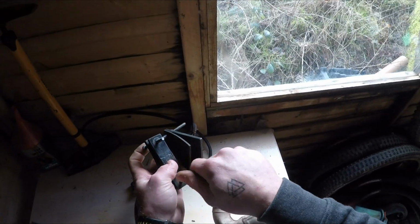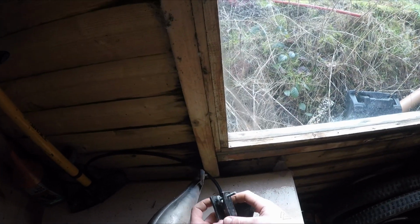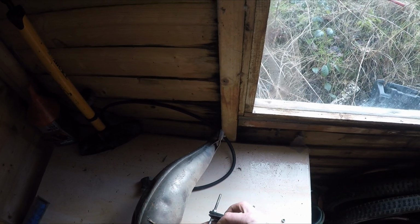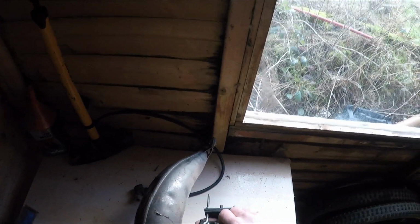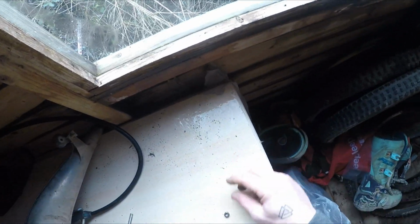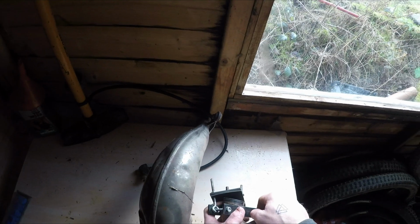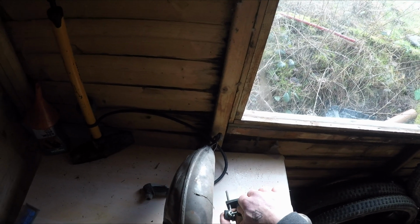This is like my worst part about two-stroke life. The exhaust is just poking out everywhere. So it's the first thing that gets hit really. You can run guards, I mean I have in the past, but what I found with carbon guards and stuff, it protects your pipe, but it also pushes the whole thing back and it actually deforms the pipe. That's just my opinion on it. Let me know what your opinion is on exhaust guards. Other than the big ones that wrap around, I'm not a major fan really.